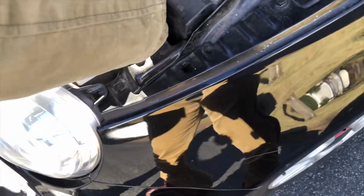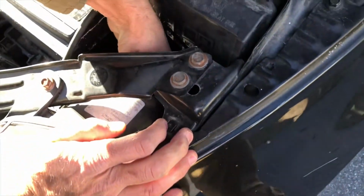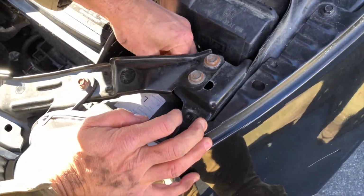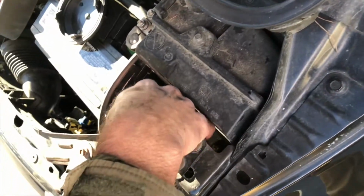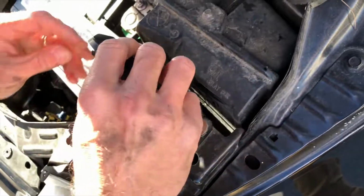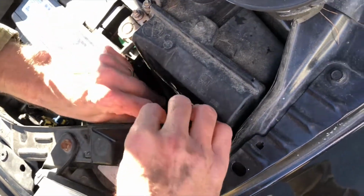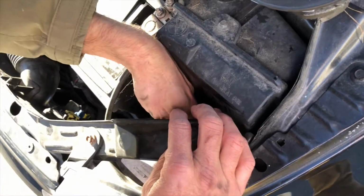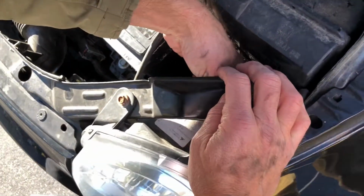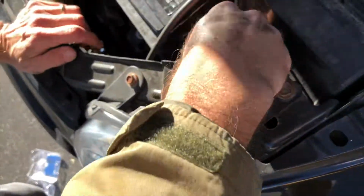Okay. It can't come out. Hold it backwards. Double check it. And it's not coming out. We're going to put the wires back in the housing, delicately, so we don't bend and ruin the wires. Plastic cap goes back on, and turn it counterclockwise that way to your left.